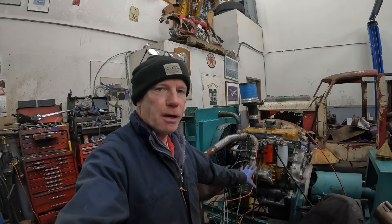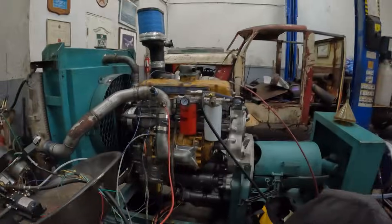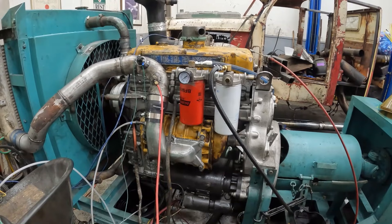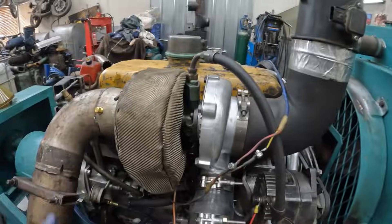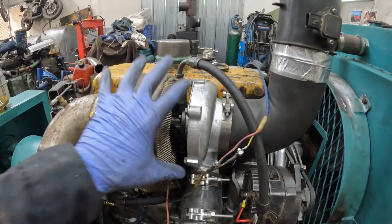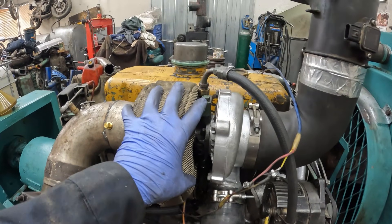It's one of the key components to make this engine run clean with a hundred CC injectors. The blower is one part that I've added here — the end blower — to increase performance. So with any luck I should see response out of this tomorrow when I do the dyno. But the turbo that's on this engine, it's a Garrett — well, truly it's a Chinese Garrett — a copy of a T04B98.